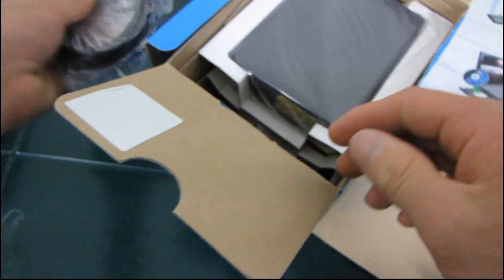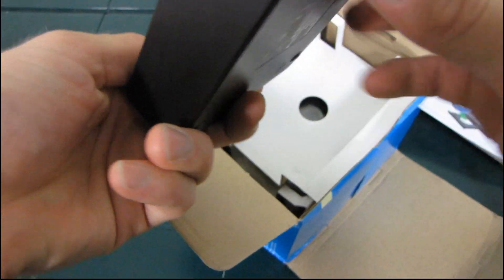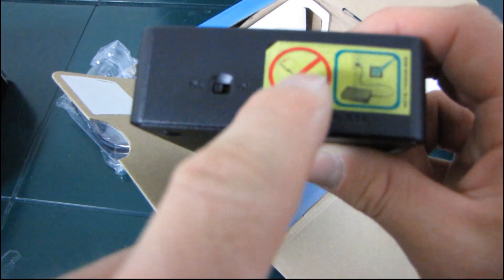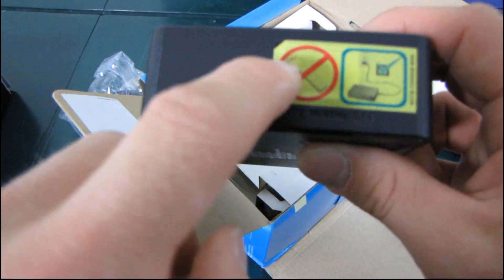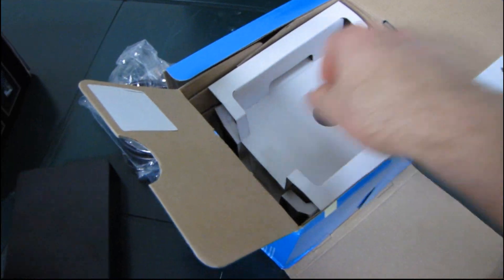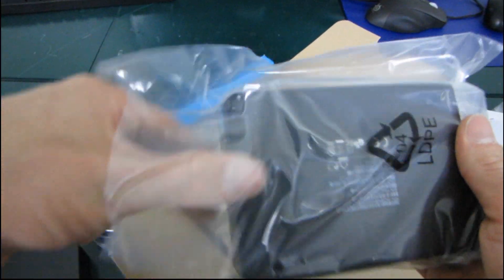So we've got a couple of Gigabit Ethernet cables. We have one Livewire. Four ports on there, as well as a sync button, which I've never actually had to use with any modern Powerline kit. There's an on/off switch in case you want to turn off your network. And there is an important little bit of instructions: you never plug a Powerline kit into a power bar — it can cause interference. You want to plug it directly into the wall, although I have seen them work through power bars before. For the best results, you always want to plug them directly into the wall.